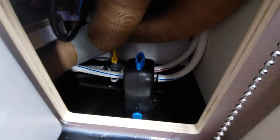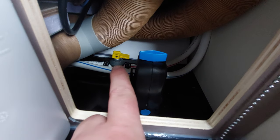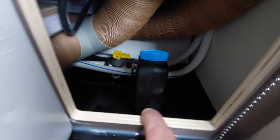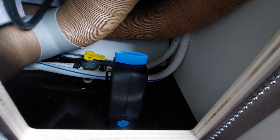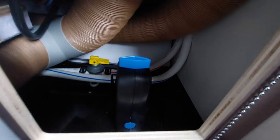The other thing you've got is this frost protection valve. There are two parts to it: first, the diamond — you've got to click it across. Then you must flick the little button at the bottom in. If it stays in, that will allow the boiler to fill up with water. If the round circle doesn't stay in, you'll need to get your heating running for a bit first, as it's heated through the pipe in this area. So: yellow button down, diamond across, and button pressed in at the bottom will allow you to fill the water in the vehicle.